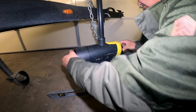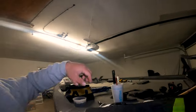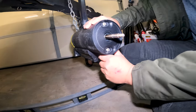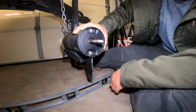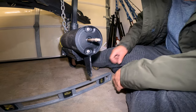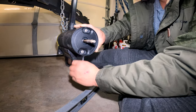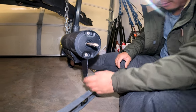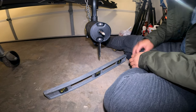Turn it back the other way. All right. So I'm going to press the button again, and we're going to listen for the sweet spot. Push the button. That sounds way better. I'd rather have it quiet, right? That sounds like you're grinding all the time. It has to be there. That's straight up and down, right? You don't have to be straight up and down. You can be a little bit off. As long as it's at the most powerful, or the quietest, it's probably the best one. It's a little bit to the left, but that sounds like it's going to be the best spot. So I'm just going to tighten it back down. Let's call it good.